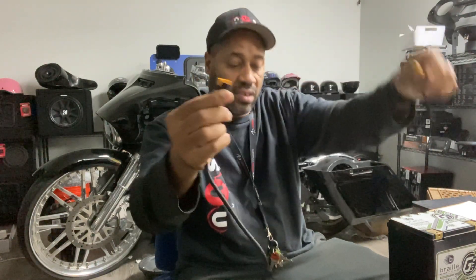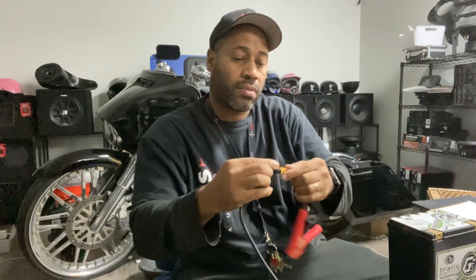There's your tender connector — it plugs into the Harley. Disconnect that and there's your alligator clamps, and then you can charge the battery like normal. It's a simple mod. We do it to every single lithium battery charger we sell with the batteries — it's just easier for the client. Nobody wants to take their seat off or fiddle underneath the bike. You get home, you plug your bike in, it's done. It's easy. Hope this helps, talk to you guys later.